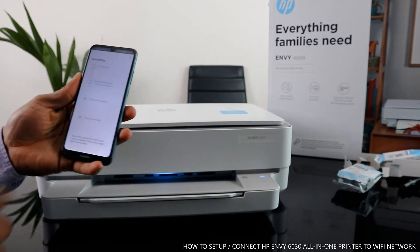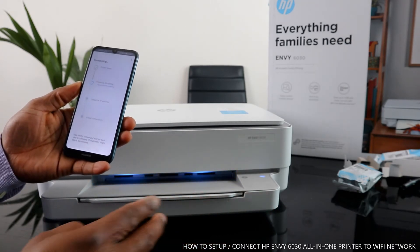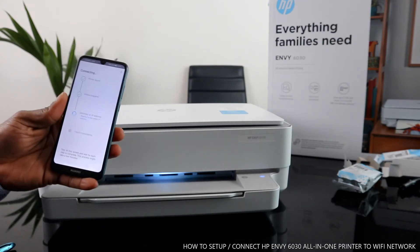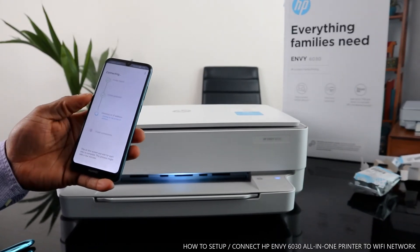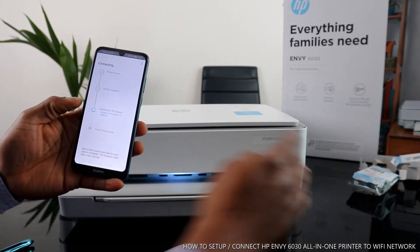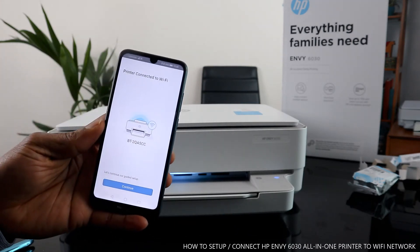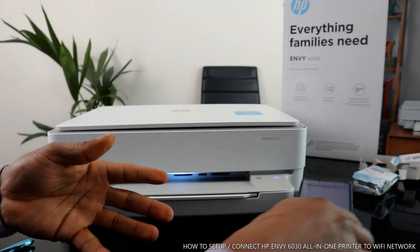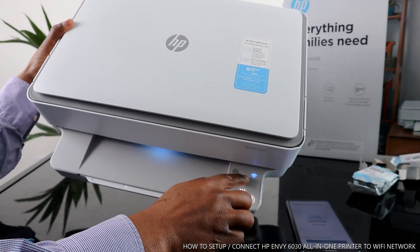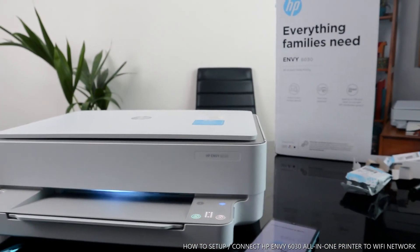After pressing the information light, you can see the Wi-Fi light flashing — a blue light flashing means the Wi-Fi is not yet connected. The app then shows 'obtaining IP address.' It's obtaining the internet IP address. The Wi-Fi light is no longer flashing, which means it's actually connected. You need to wait for this to complete on the app. The app now shows 'printer connected to Wi-Fi network.' If you look at the printer, you can see a steady blue light, confirming the Wi-Fi is connected.